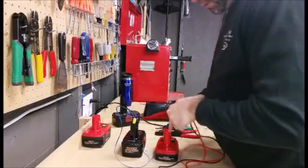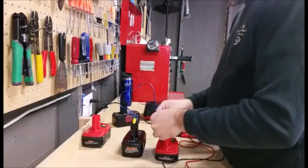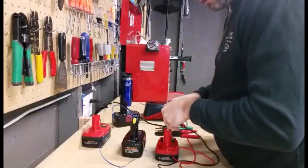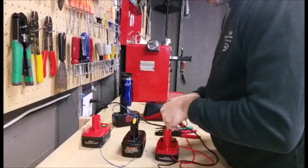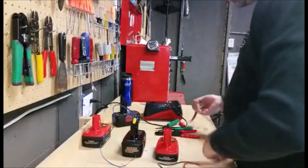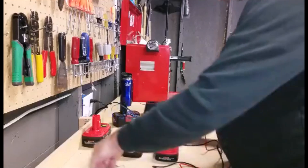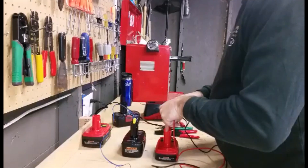Starting voltage on this battery was 4.7 volts. Like the guy on the internet did, he just kind of sparked it. I'm going to hit it once, twice, three times. He did it three times with his trickle charger — let's see if it changed anything. Already we're at 5.6 volts. I basically want to get this battery up to around 9 volts or something like that so the charger can take it. I'm going to hit this one more time — one, two, three. Now we're at about 6 volts.